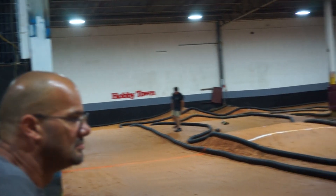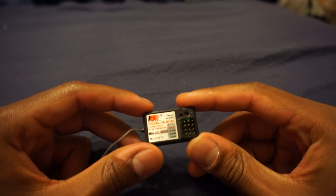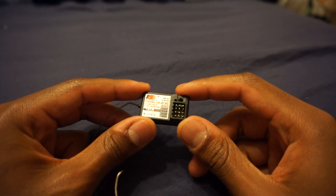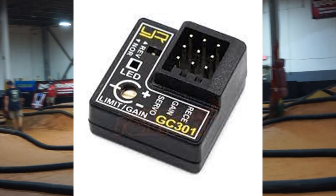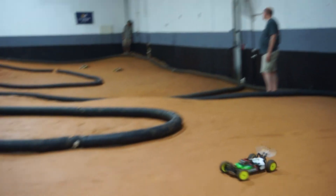I'm going to rapid fire through a few of the simpler parts of an RC car. The receiver is what connects your car to your transmitter. It also receives power from the ESC and diverts that power to the other parts of the car like the servo or any other accessories. You plug the servo into channel 1 and the ESC into channel 2. The transponder is what allows the track hardware to register your laps — they are also stupidly expensive. A gyro is almost never used in racing as they are considered a driver aid and thus not allowed; you'll only see them in drifting cars. And lastly, there's a fan. It's a fan. And that's all the electronics you'll see in an RC racing rig.